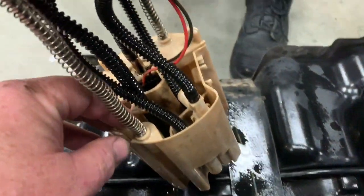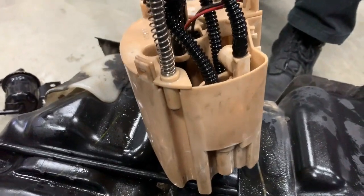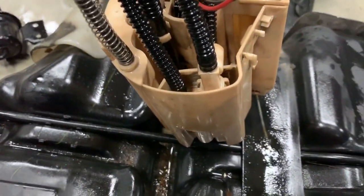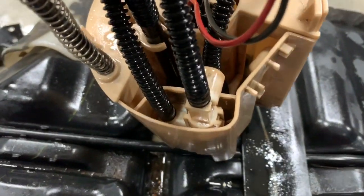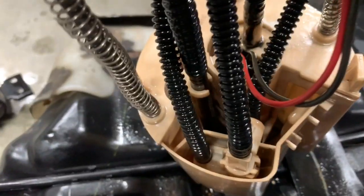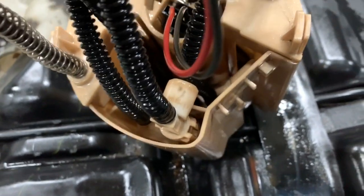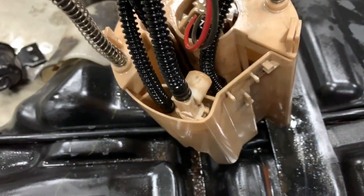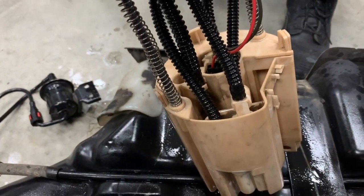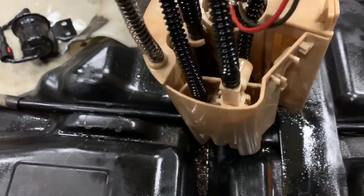So here you go. You can see we've clipped the fuel pump back into the swirl pot. You can see the bypass valve clipped onto the little Venturi assembly, and also the return line from that. And just remember, don't forget to put the O-ring in. We're going to trace the rest of the lines and try and make sense of the circuit.